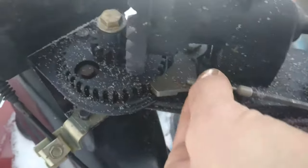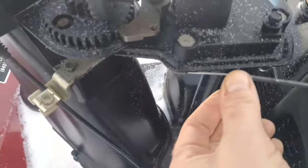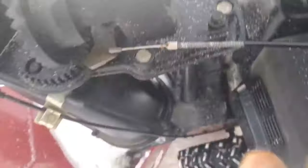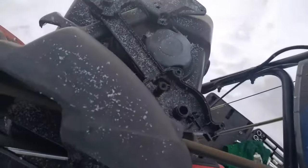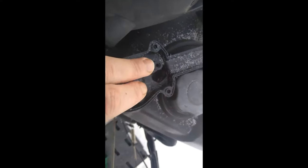Once you get this nice and lubed, you can fit it back in here. Before you do, make sure this locking mechanism moves really easily — that might be your issue instead. You're gonna put your cable back in and move it in and out by hand to confirm it slides very easily. Keep it as straight as possible all the way up. For this part, I'm gonna use some dielectric grease — you can get this at AutoZone or wherever. It doesn't freeze. You just need a little tiny bit.